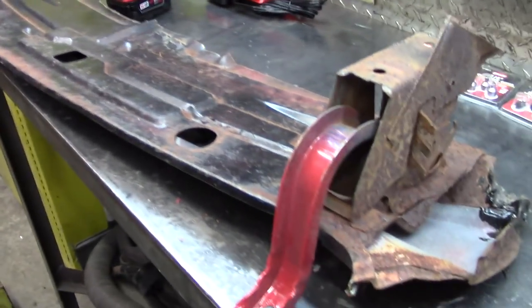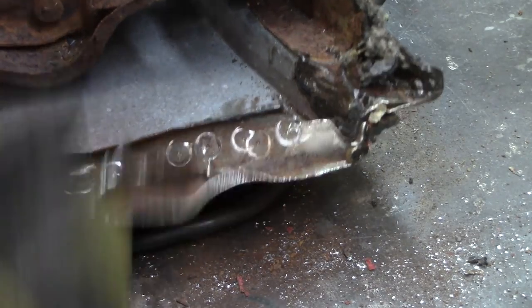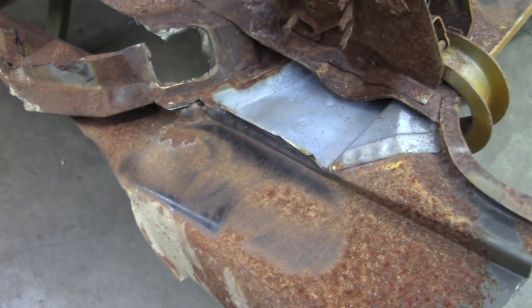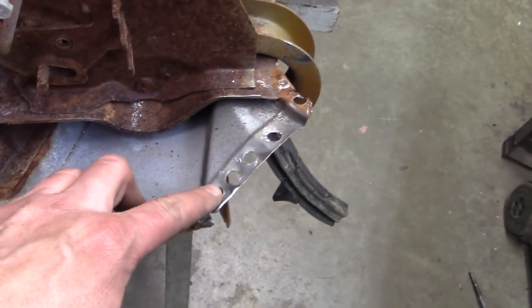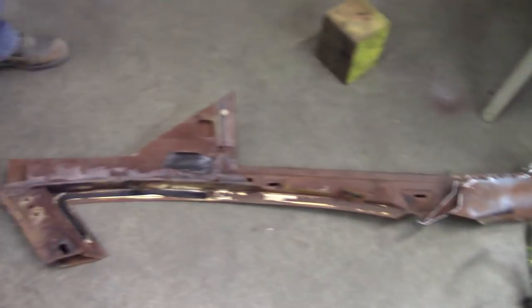This piece is less than perfect. What I've learned from this is this job is going to be a complete pain. Starting in on this piece, I realize if you look from the back side where all the rust is, this is where all the spot welds are, so I have a little bit of a clue where to do the cuts. There is the first piece, separated — and how long would you say I was working on that? About an hour. I kind of accidentally went through in a couple spots there, and then we're going to weld this from the bottom anyway, so I just purposely went through. It's one step closer — just keep chipping away, it's going to be a lot of work just to get this piece cleaned up.